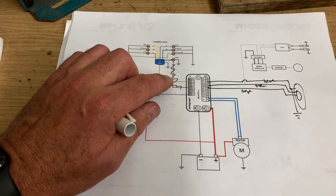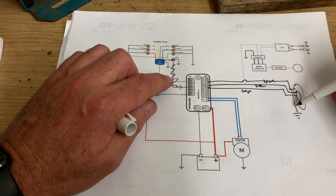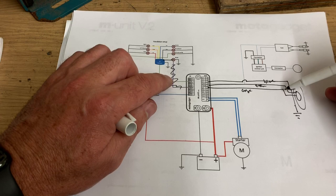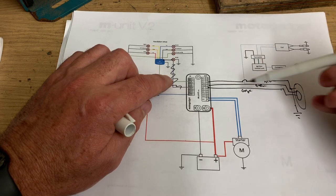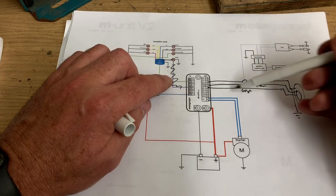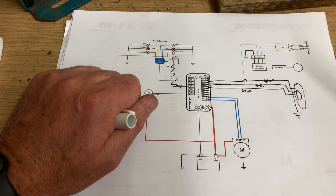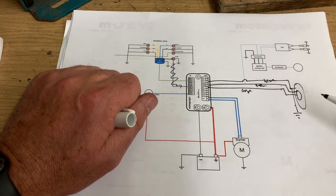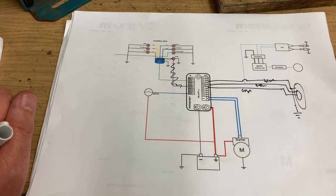Okay, in terms of wiring up for the lights, therefore, I've got a single connector. It's got an earth on it. It's got a low beam, a high beam, and the halo. So the halo goes from the aux one. The high beam goes from the high beam, obviously, and the low beam goes from the one that says light. And they are orange, green, and blue in that order. And there's an earth. I will draw that again nicely in PowerPoint.